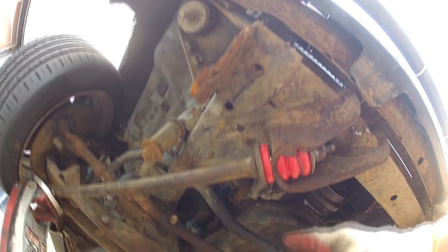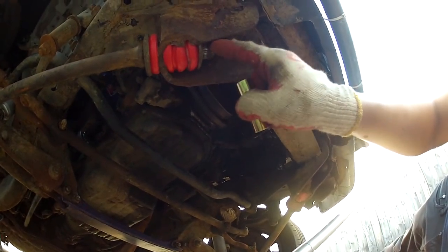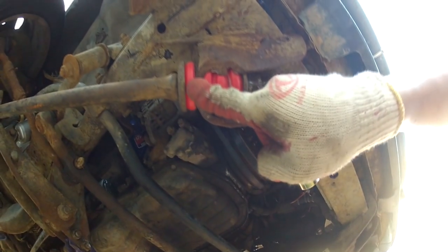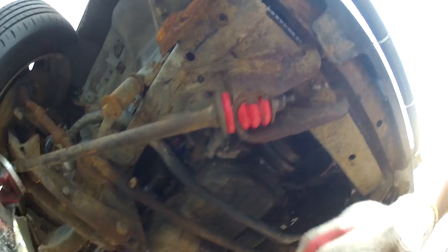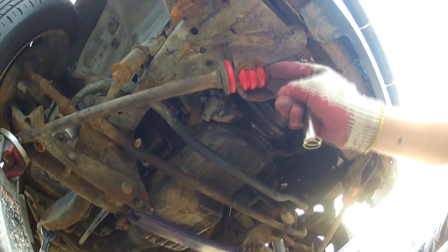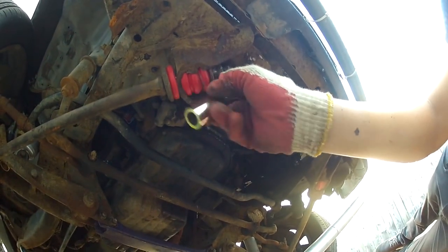That's it. Not sure if you saw, but the other piece that I cut off, I put it here because there's a sleeve that goes in there, and if I didn't put this in here, the nut would have hit this piece, and there would be a huge gigantic gap, so this thing would be shifting back and forth while I'm driving, which is not ideal, not safe, so I put that in there just in case. You can also stack washers up in there, that's your option, as long as it fits through this sleeve. But yeah, this sleeve is required, and I definitely recommend using the leftover bushing that you chopped off. And you repeat the same thing on the other side.